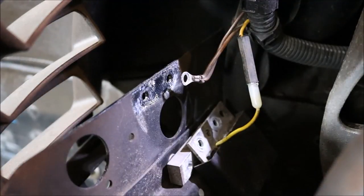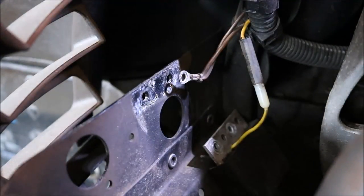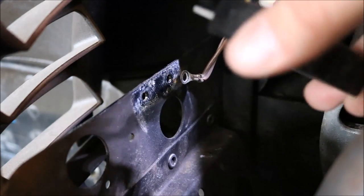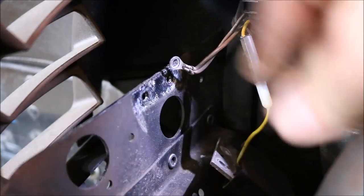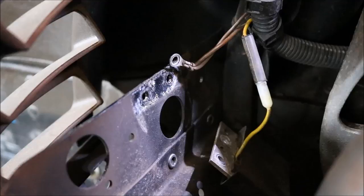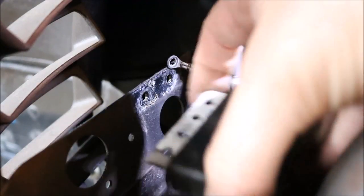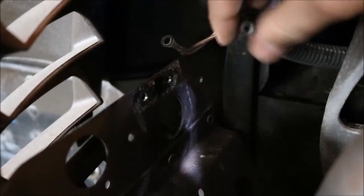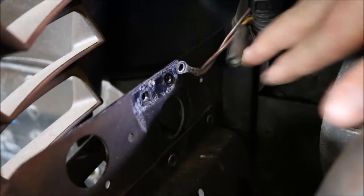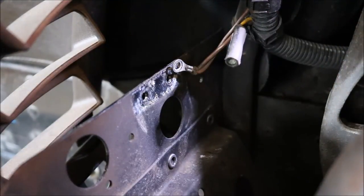So now you can see we have two bolts. There's a small spacer that goes in the back — it's not threaded, as it shouldn't be. Then you have your actual voltage regulator hooked in with one yellow wire, and this is a ground which is also connected to a chassis ground somewhere else in the actual harness. We'll get this electrical connector taken off — it just pulls right off. It's a standard buck connector.